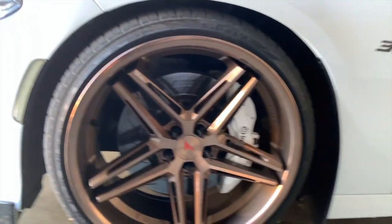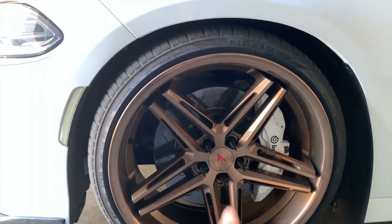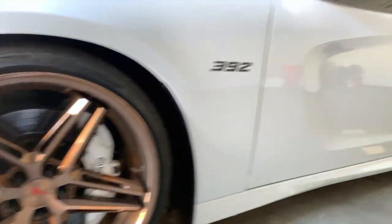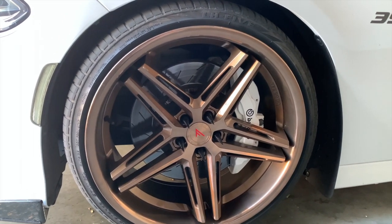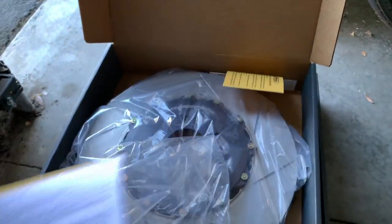You can see the groove — I don't know if it's called scoring or gouging, but this rotor definitely needs to be changed out. The rotors I decided to go with — because changing from four-piston brakes to six-pistons, those are much heavier, and that added weight was definitely noticeable when driving. The fix is lightweight rotors made by Demon Performance.